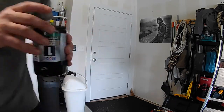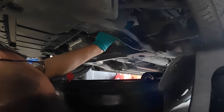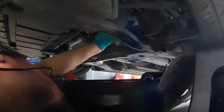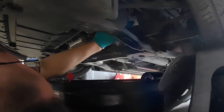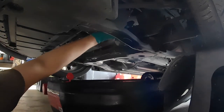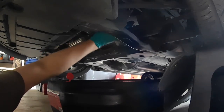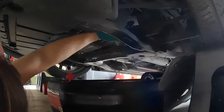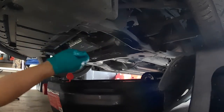Now that that's done, we'll put it on. Back under the car — put your oil filter back up. You're going to want a little bit of grip to get this on there, or at least get it started. Just twist that on. I typically hand-tighten it; some people use an oil filter wrench — I don't have one. I'll make sure this is good and hand-tighten. That should be good and sealed up there now.